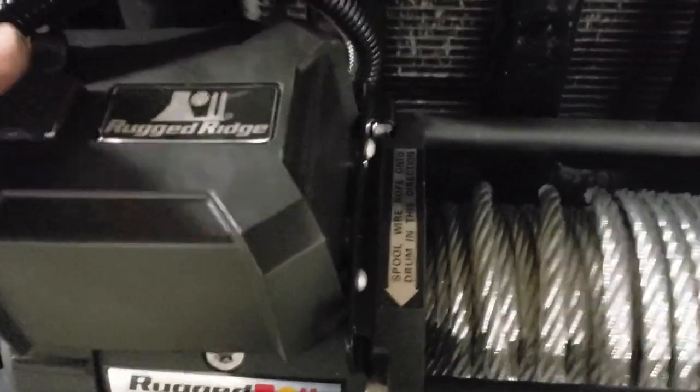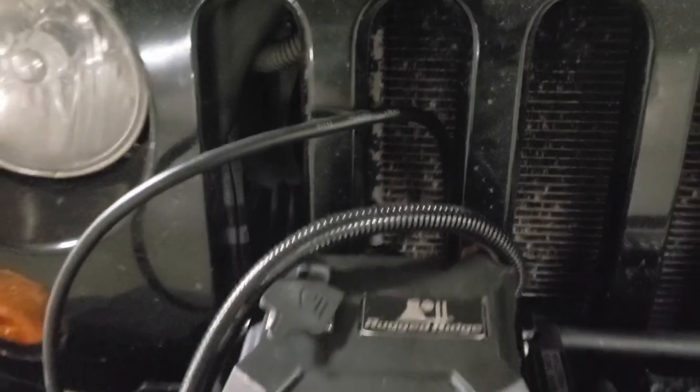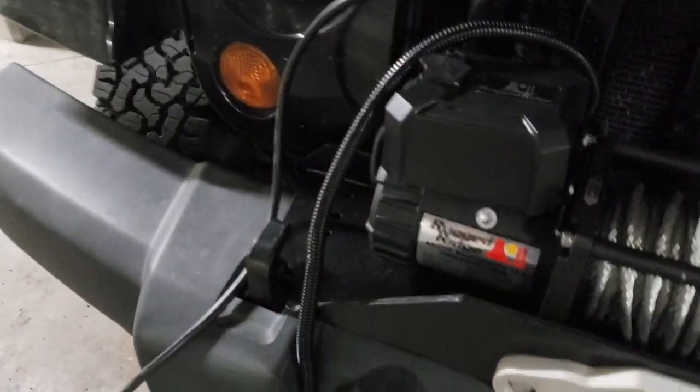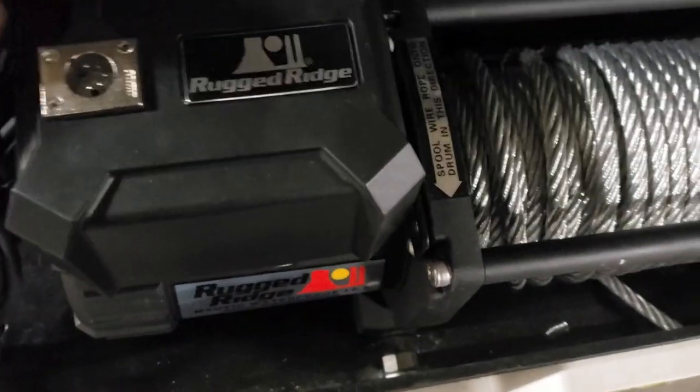She's all bolted up. Got the solenoid pack mounted — I opted to mount it directly above the motor. It gives you four different positions, but I thought that best suited what I wanted. My theory was it blocks a little less of the radiator putting it off to the side. One thing to note: hook up your bottom wires before you mount the winch on the plate, because doing it after was terrible. For wiring, it's straightforward — run negative to negative, positive to positive, and there's no need for an external relay; it's all contained inside the box. I fed the wires through a little hole right beside the power steering reservoir and ran it along the inner fender up to the battery.